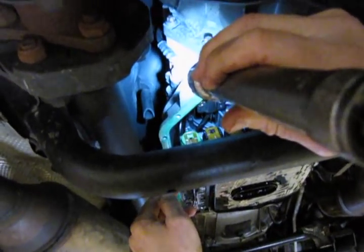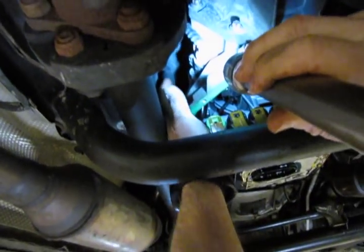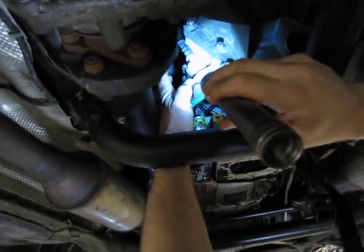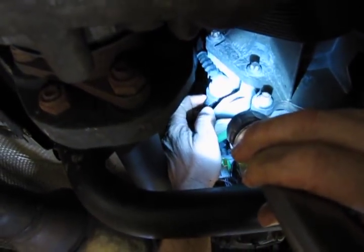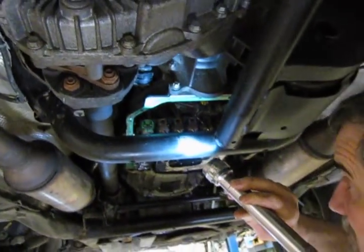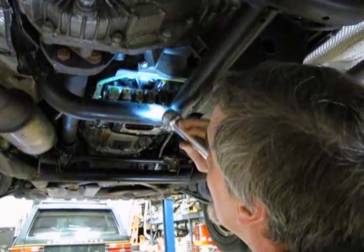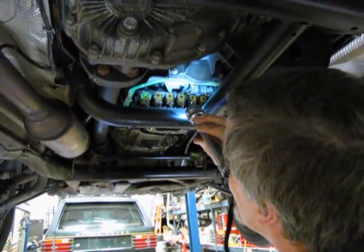So we have the pan down. Now what we're going to do is disconnect the harness connector from the internal harness. If you look in the back of the passenger side of the transmission, you'll see the electrical connector. There's a large tab right here — we're going to pull down on that tab, which just basically unlocks the connector and pulls that right off. So now from this point we get up underneath and we just start unplugging the solenoids and the two sensors. Keep in mind, watch your locations because we want to get everything back in exactly the way it came out.